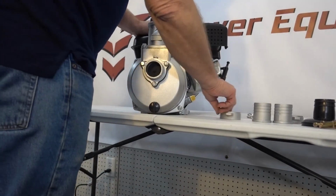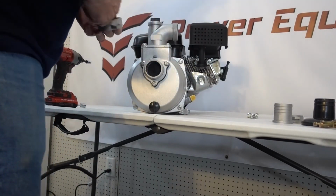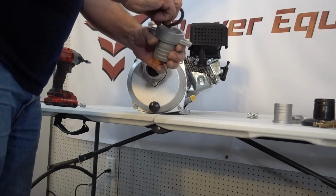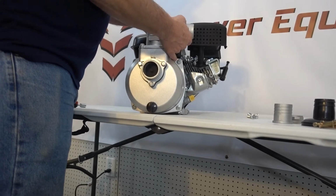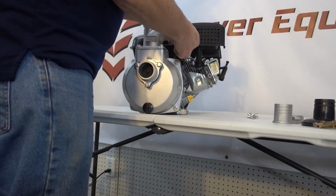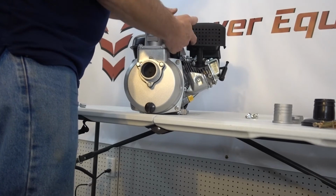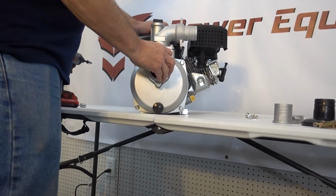So these extra components are basically so you can slip your hose on there. You would put your coupling in there like that. You would put the flat O-ring on there and spin that on. And then you've got a hose barb, same thing for the front one.